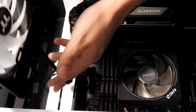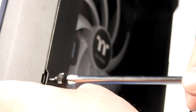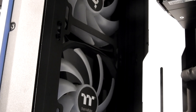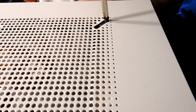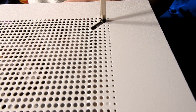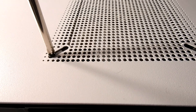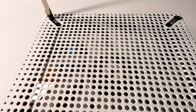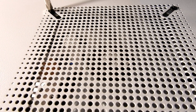To put it back, you just feed the cables through. It does sit kind of at an angle — it should look something like that. For the top fan, feed the cable through, line up the holes, and mount it. The top fan is the exhaust fan because this PC already has a back exhaust fan that's 120 millimeters, so we're adding a 140 millimeter exhaust fan on top. This should hopefully lower temperatures — we'll see in the benchmarks later.